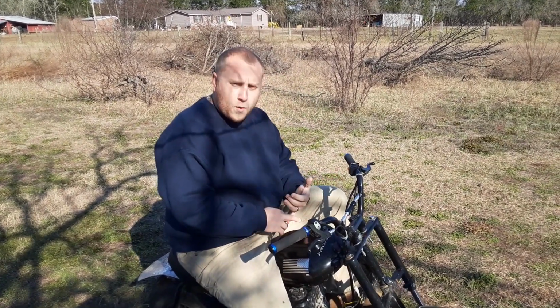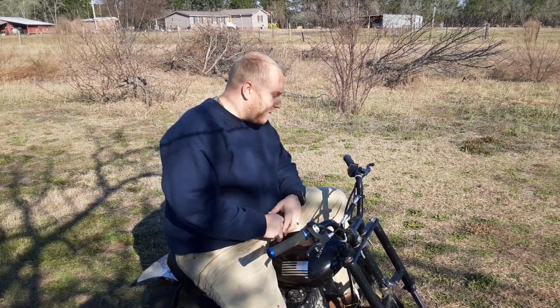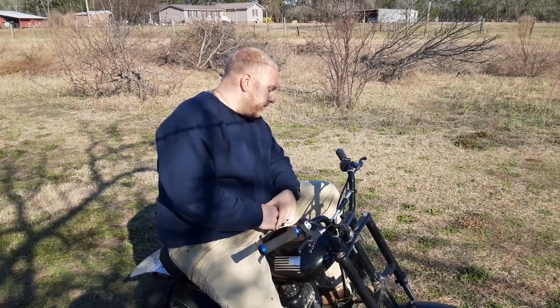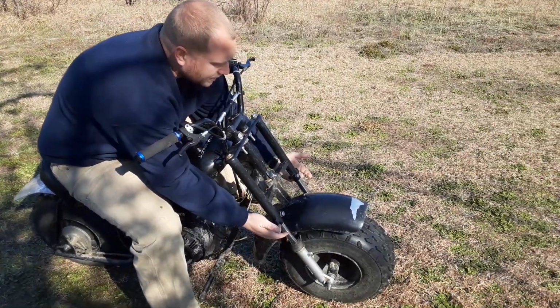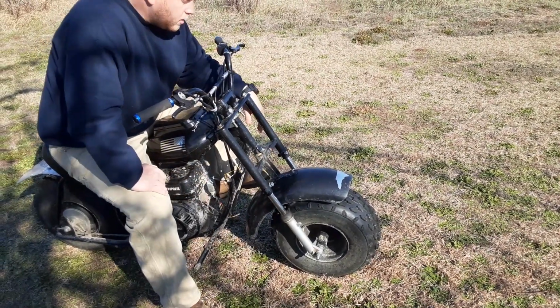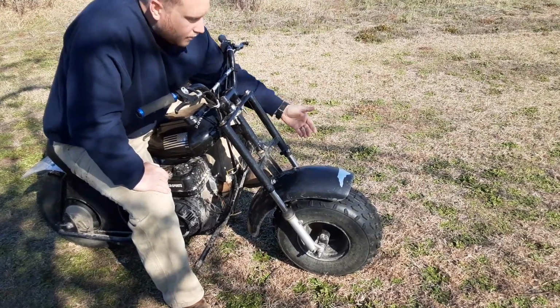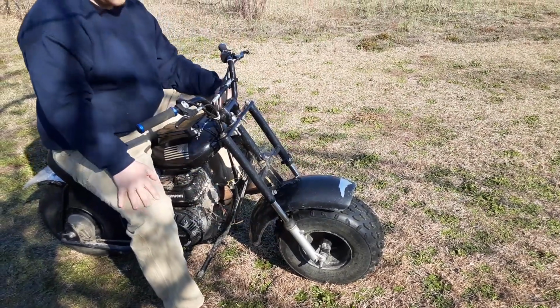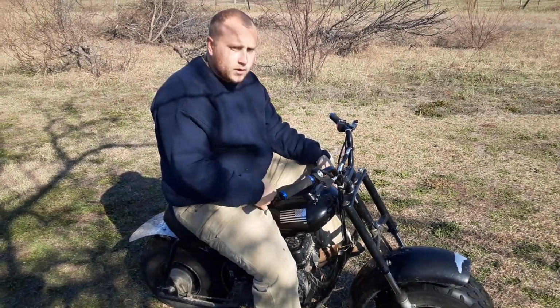They're like $40. I'll put a link in the description of where to get these. Like we said, we had to make a shim to go inside the shaft. That wasn't very hard, and we also had to drill the holes down here for the axle. We used a 5/8 drill bit. It had a little play, but the factory forks had a little play too.